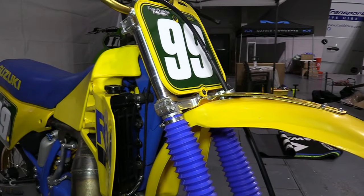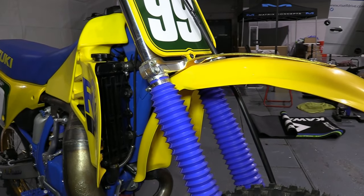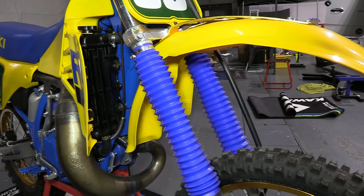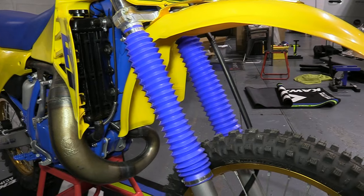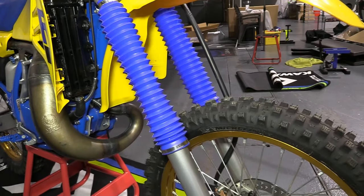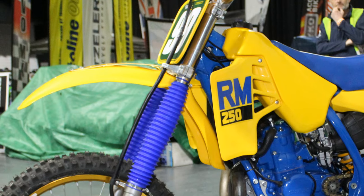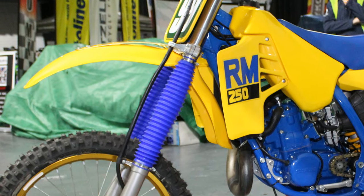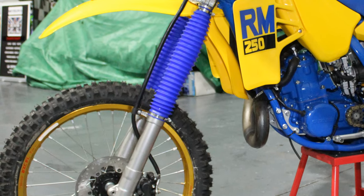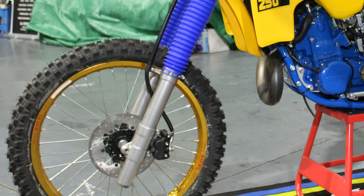As we move on to the front end of our 88 RM, it was a pair of 43mm Kayaba forks — the cartridge variety. These Kayabas were certainly up there with some of the best motocross suspensions available in that year, because they did have some capability to make changes to the rebound and damping, which for an 88 was quite a big deal when it came to suspension tuning. But if you were a fast and furious rider on one of these 250s back in the day, you may have found these forks were maybe a bit on the soft side — though for an average club rider, these Kayabas were almost perfect.